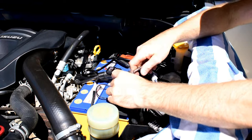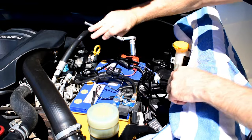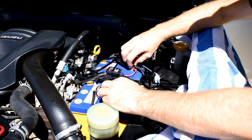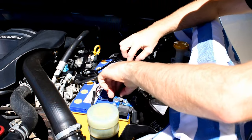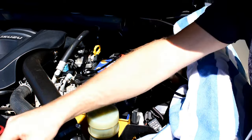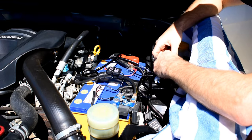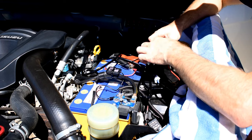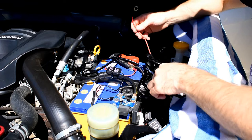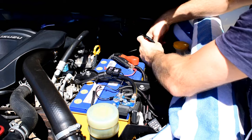Now I've figured out where to run my wiring, the first step is to mount the relay. I'm just going to take the 10mm bolt out of this little filler neck and use that to mount my relay. Now that the relay's mounted nice and sturdy, I can run the rest of the wiring. I'll get my 13mm socket and loosen off the accessory terminals on the battery. What I like to do is fit the power and earth first, but pull out the fuse so you can fit it later — that means there's no power going through the system so you're not going to risk arcing anything out when you run stuff through the firewall.